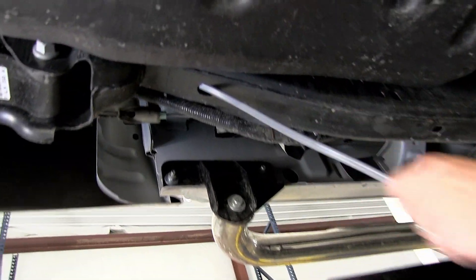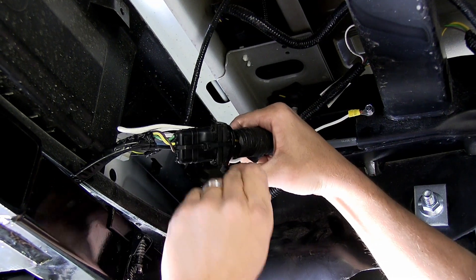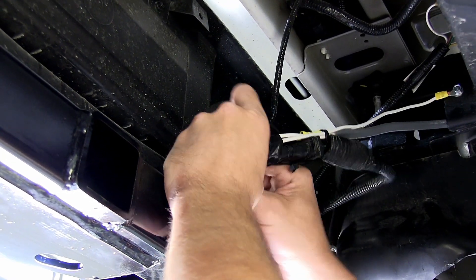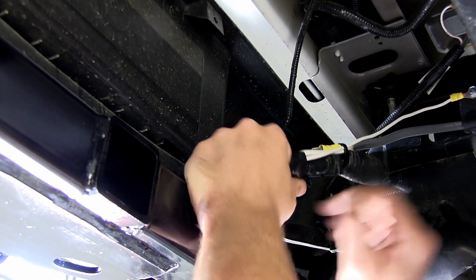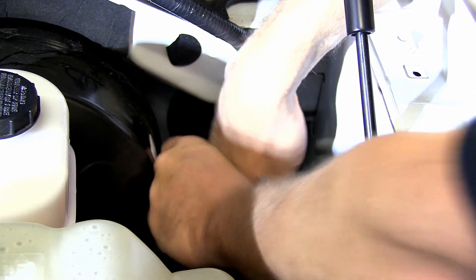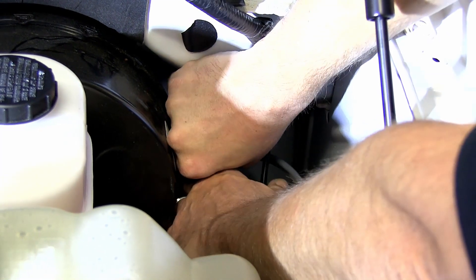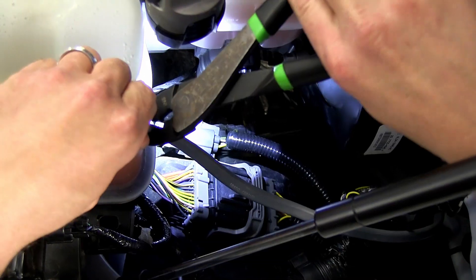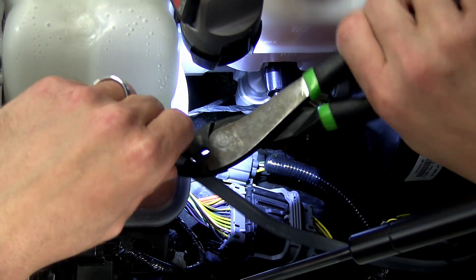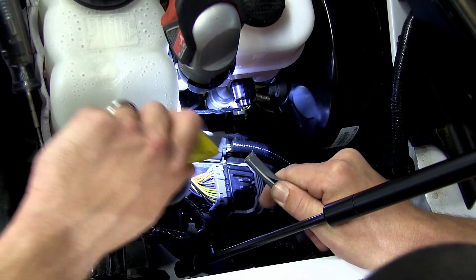Now with my wire fed into the frame, we can come back here to the hitch and the 7-pole, use some black zip ties and our black electrical tape to clean up our install look and secure our wiring. Now that we've got our new duplex wire running into the engine compartment, we've gone ahead and secured it with some black zip ties. Next I'm going to go ahead and measure the length that we'll need and cut off the excess. Now we can go ahead and strip back the sheathing and strip back our white and black wire.